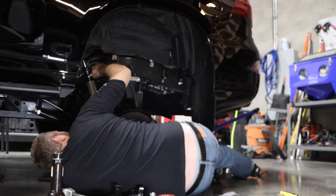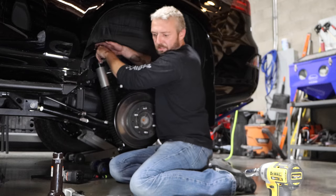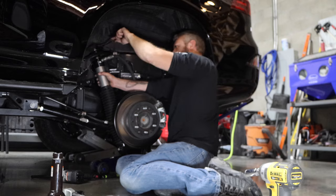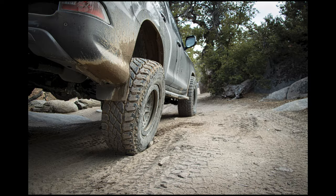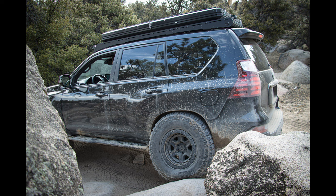The final step is installing your rear coils and rear shocks. I used ARB 898 coils — when I get my Long Range America tank and rear bumper, I'll put 899 coils in. Coil choice is personal preference depending on your weight. The coils are a little bit longer than factory, so I needed to use compressors and the factory jack to get the axle down, and that's because I have KDSS — without KDSS it'd be a bit easier. I did not put braided brake lines in; I didn't find them a necessity right now — when I go to a mid-travel kit in the future, that's when I'll deal with the brake lines. Here are some photos of the rear flex — it can go up higher in jumps, but when standing stable on a rock it won't go all the way up. The rear mud flap does rub slightly, but since I'm getting a rear bumper anyway, I'm not worried. If you don't get a rear bumper, get rid of those mud flaps and you should have no rub.